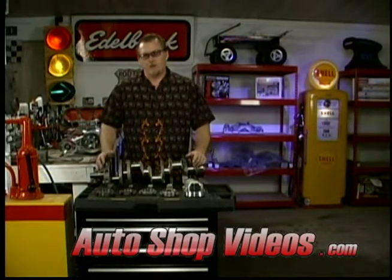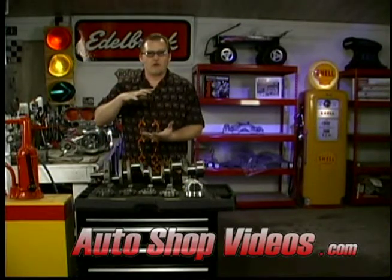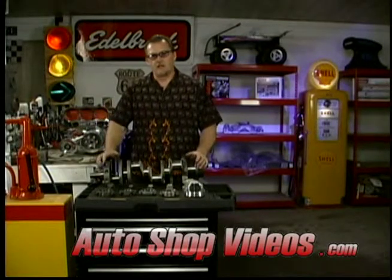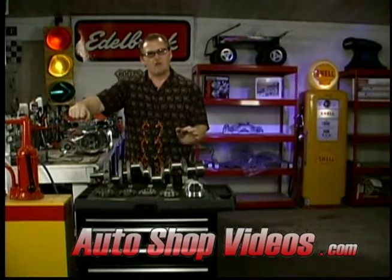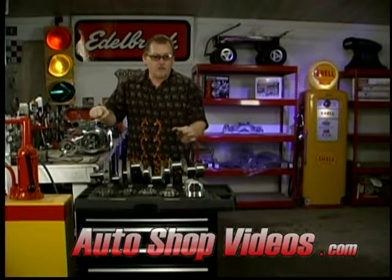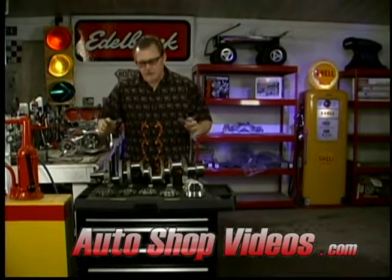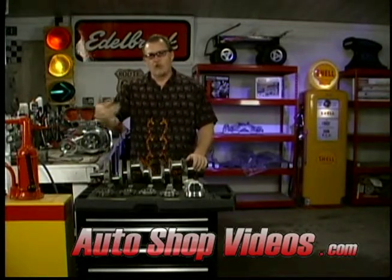The idea of horsepower is to fill the cylinder, create more pressure, and push the crank around harder. Blowers do that. The problem is it creates more strain. It's like a breaker bar with a socket — if that socket will take 200 pounds of pressure and you run it at 190 or 195 pounds all day, sooner or later that thing's going to give. But at 50 pounds it'll last forever. It's the same thing with engine internals and blower motors — they're putting strain on parts.